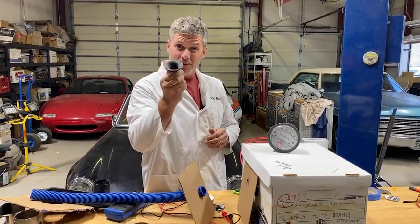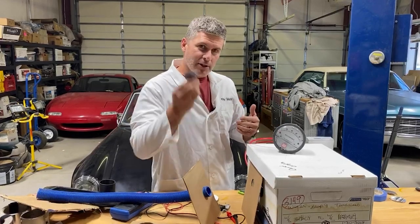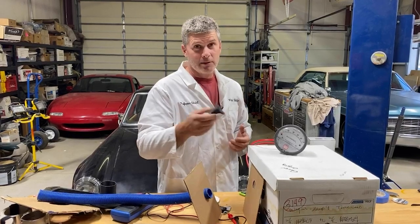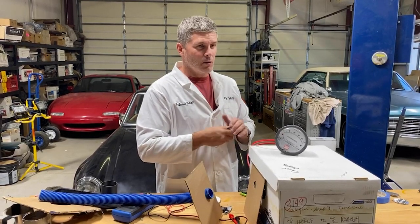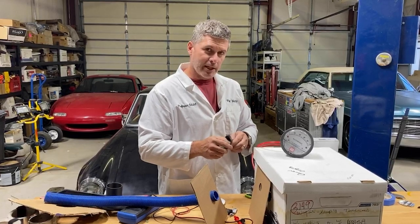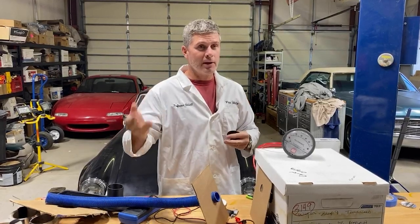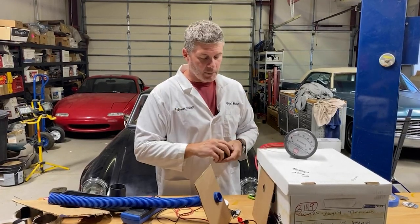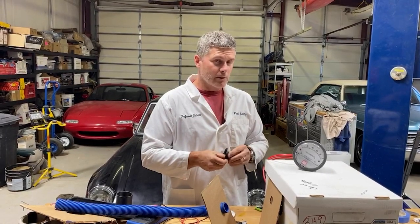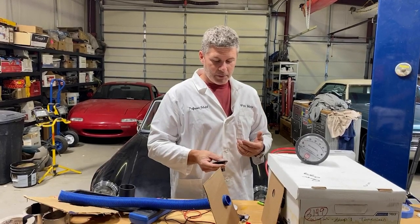So we have proven that even a failed experiment, if you keep doing your research, if you keep trying to figure out what it is, playing with your experimental apparatus, you can prove that the thing is working. Sometimes we do prove that they don't work. When we were doing radiator testing, when we developed our cross-flow radiator, which was the first widely available cross-flow radiator for the Miata, might have been the first one, period, poor Brandon locked himself in our dyno room with an engine that we could set to a specific load, and he basically would run for half an hour and measure temperatures, how fast it came up. And we learned a lot of really interesting things about radiators because we had a very tightly controlled experiment. And some of the radiators that we had specially built for this test completely and utterly fell on their faces. And that's an example of the experiment.